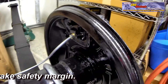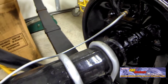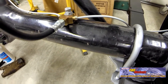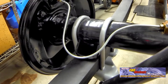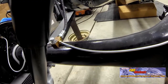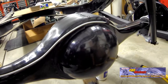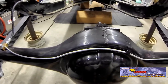Note that the tubing does not rub against any metal objects. The bends in the tubing create enough tension that these tubes will not vibrate. The somewhat unusual loop in the tubing is actually an exact emulation of the factory bends. The long tube requires two clips along the axle housing to keep the tubing from flexing, vibrating, or moving. These clips were factory installed.